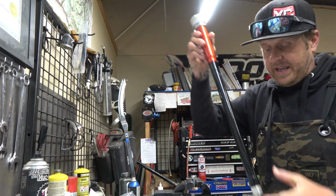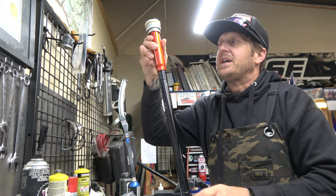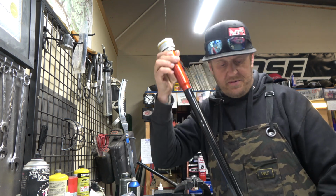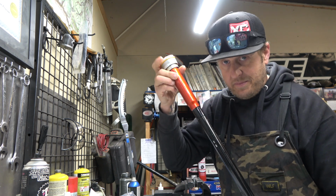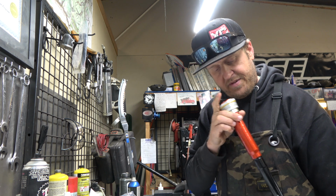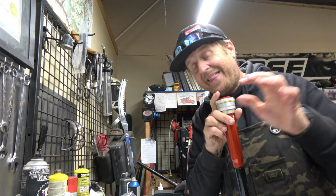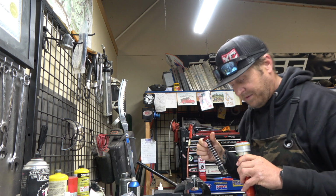Alright guys, real quick, sorry about the sound changing here. I got my mics charging up. You bleed this like you would any other twin chamber. Just pour oil in there, pump it up and down slowly, get all the bubbles out, and then we're going to reinstall the compression valve. Then that's where it gets different from a normal fork on installing this. Although not terribly different, just a little bit.